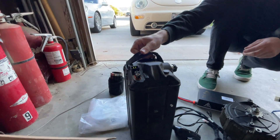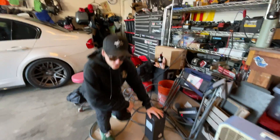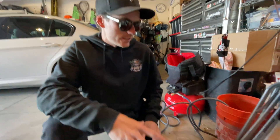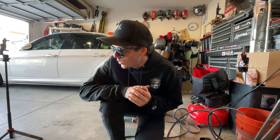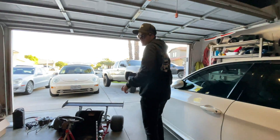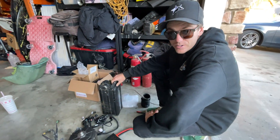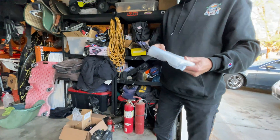You're gonna need a battery of some sort. This is the cheapest option — a Suron/Segway battery — which will work. Or you can upgrade and get something like this Chai battery right here. This is a 72-volt battery; stock Suron is on 60-volt, or the budget one is a 48-volt battery. That just depends on how fast you want to go. This battery you can probably find for like 400-500 bucks; that battery over there is like $2,500.